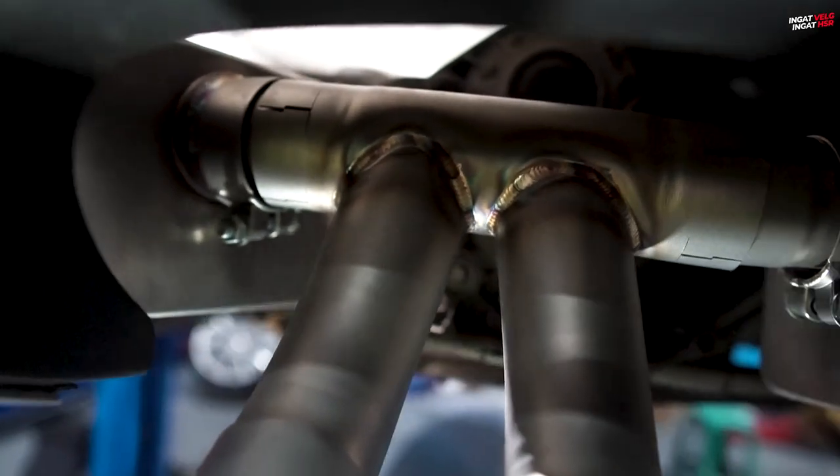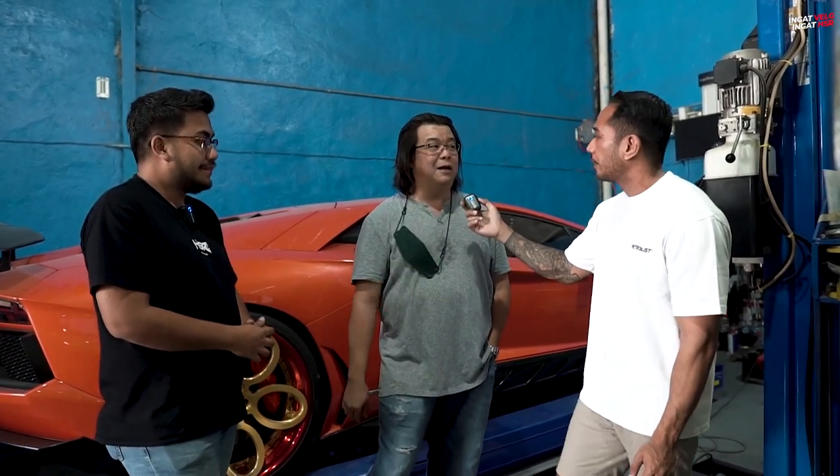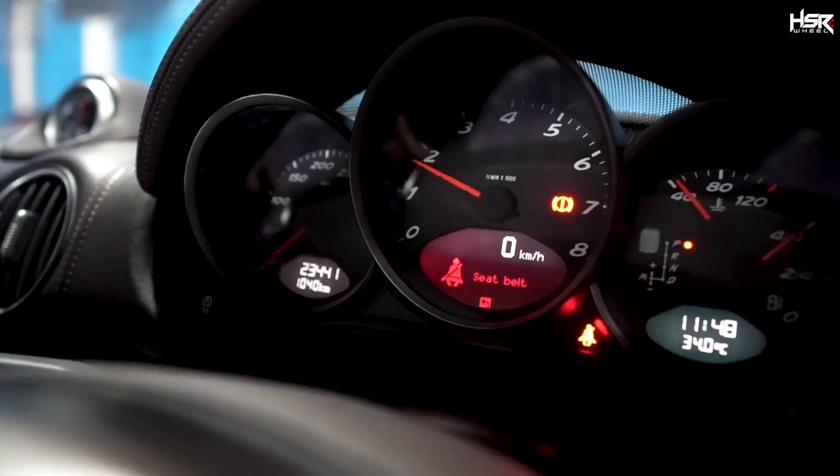So he can go on-off. If you're in the car and you press the gas, the valve opens. This exhaust, the way it works — when it comes in at RPM 3500, it automatically opens. Then when it comes to high RPM, the valve opens fully. But if you use the remote, you can set it on or off manually. If you want it always open, it's always on. If you want to close it, just change it with the remote. That's how you control the sound.